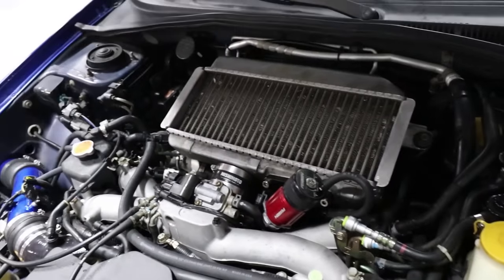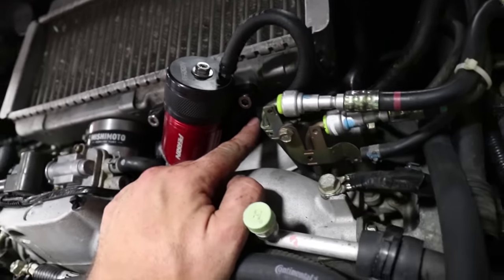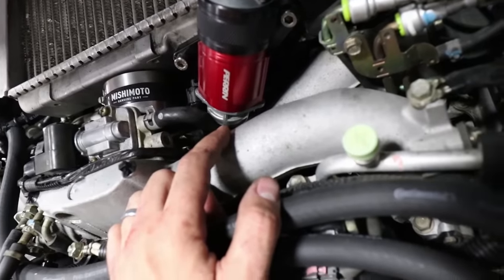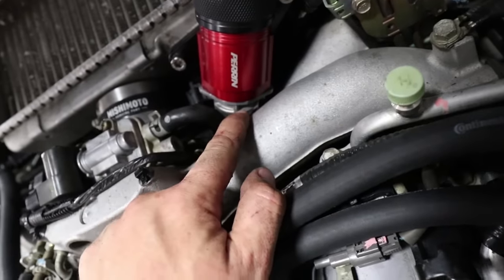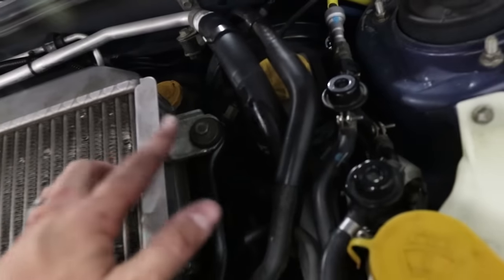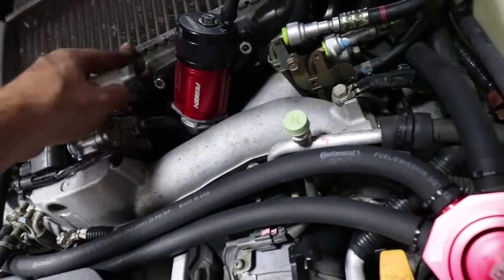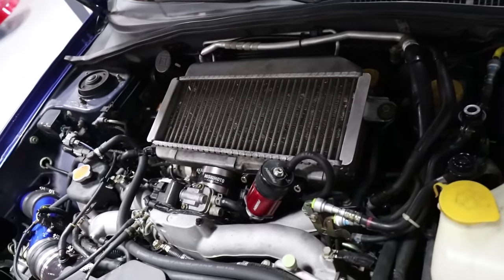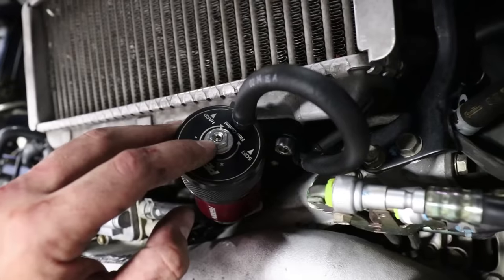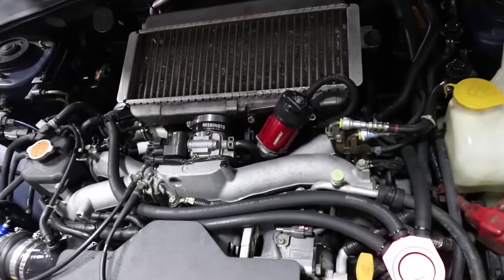Everything is back together and bolted down nice and tight. We've got zip ties on all the vacuum lines, all the crankcase stuff routed underneath the intake manifold, and the intercooler is tightened back down. I did have a little trouble bolting the blow valve because this elbow is very close to the top of the intake manifold, so I recommend loosening up these two couplers and unbolting this bolt here so the intercooler has a little movement. Torque is only about 11 to 15 foot-pounds since this is an aluminum intercooler. Because the car is stock and not tuned yet, I'm not going to adjust any of the flow controls — we'll wait for Delicious Tuning to make adjustments. Let's start the car and make sure there are no vacuum leaks.